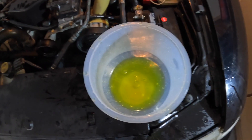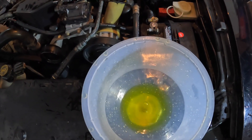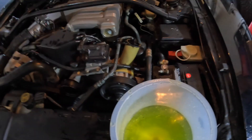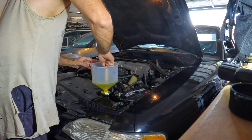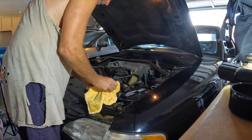The thermostat just turned on again and it's still bubbling. I'm not sure when I'm supposed to stop - I'm assuming it's when the bubbling stops but it's still going. I added more coolant and now it's going down again. After it went down and I added more coolant, a lot of the bubbling is starting to stop so I'm going to call this done. I'm putting the stopper in - careful because it's pretty hot - and sealing it up. It didn't work ideally but I think it did its job getting all the air out of the system.